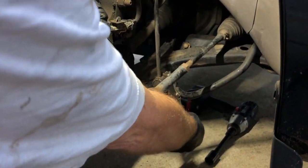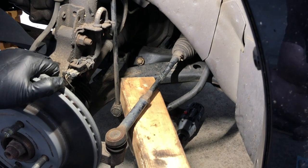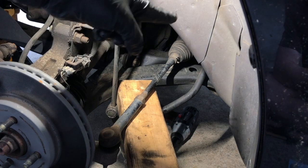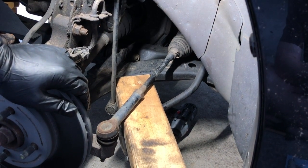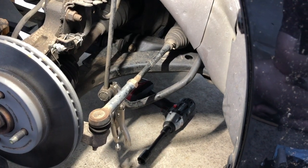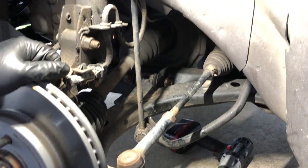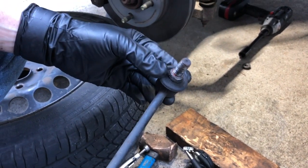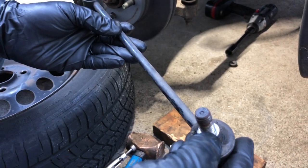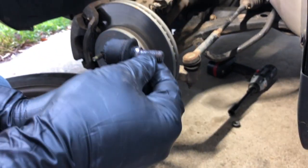The bottom came off with just the vice grips. To show you what I ended up doing: take a small 2x4, get it wedged in here a little bit on the tie rod, and push it down just a little. You don't want to damage the bushing — just push it down enough so you can get your impact wrench underneath. I've got a couple of jack stands for safety. At this point we've got this extracted, and you can see the top is pretty well rounded off and the bottom is also pretty well rounded off, with corrosion having grabbed the nut in both cases.